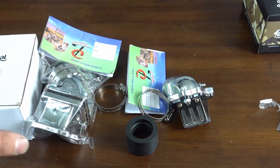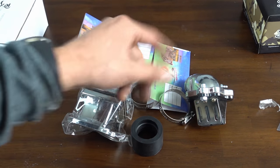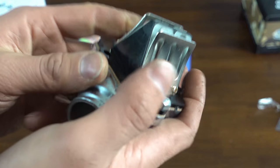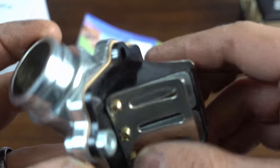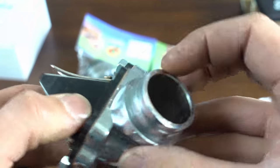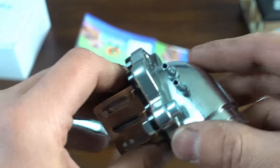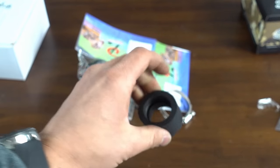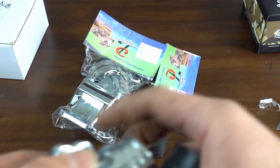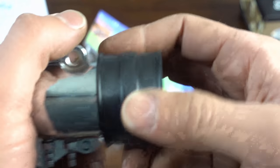Just be prepared for what you're going to get. This is about $30 and the other is about the same — same company, two different suppliers. What I find comical about this is they give you a gasket between your intake and reeds, but you're left with no gasket on the engine side, which is the one that's going to see heat and fail. So when you go to replace it, you'll need to buy a gasket as well — about $6-9 at your dealer. So $29 for this shipped, plus $10 for a gasket and a better boot, puts you at about $49.